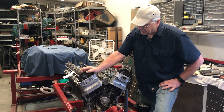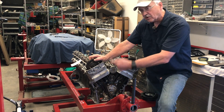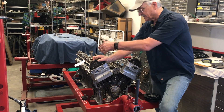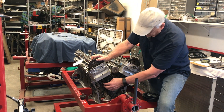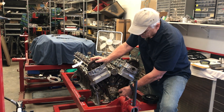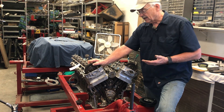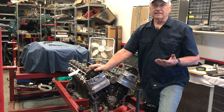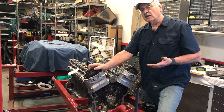It's just got to be done right. The engine rotates clockwise as viewed from the front — if this side of the chain is loose, you can have the cams in the right position and the tensioner unlatched, but as soon as you turn the engine over the crankshaft sprocket pulls the slack out of this chain and starts pulling on the camshafts too late. Your camshafts are retarded and you might not notice it, but the engine is not going to run as well as it should.